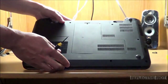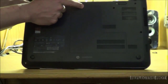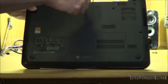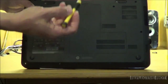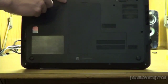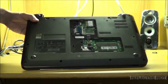Now you see you have this panel right here — the center panel that looks like the shape of an L. You only have one screw up here at the top, so go ahead and remove this screw. The screw doesn't completely come out — you hear how it clicks? That means it's completely loosened. Then take either a flathead or the same screwdriver and just pry it down until the clips pop. After that, just continue to pull — it's not going to break. Set it off safely to the side.